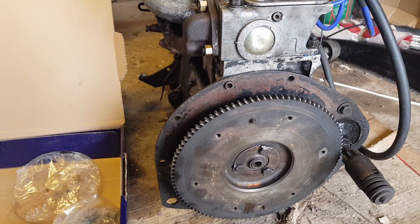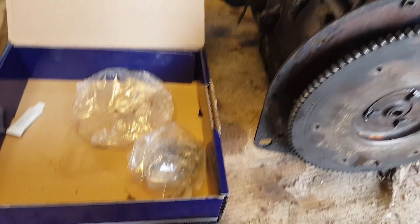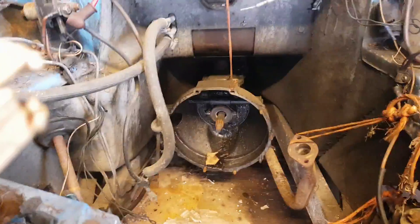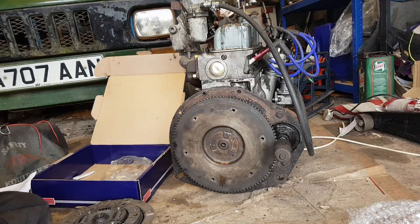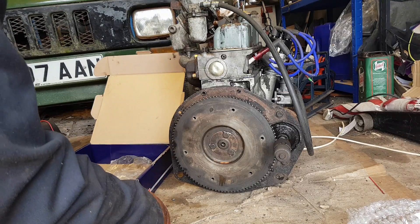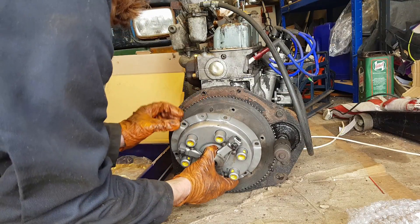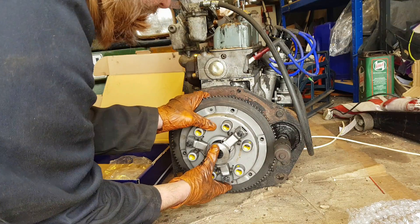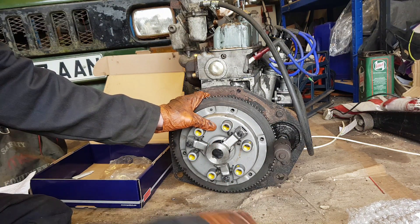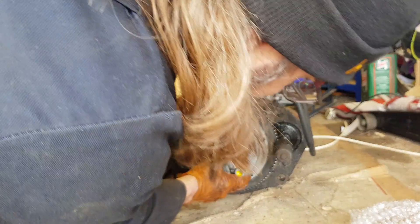The thrust bearing actually goes straight on the shaft. You can see the old thrust bearing is still there, so I've got to get in the engine bay and replace that at some point, which should be tremendous fun. There should be a dowel there and there — okay, there's one locating dowel. Now we shall start all these off and then get everything lined up. Slightly concerning but it doesn't want to actually go flat.